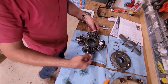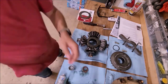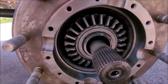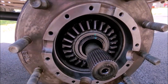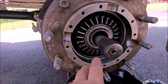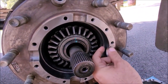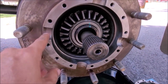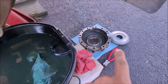The next thing is to replace the four O-rings because this is going back on again. Off camera, I slid the axle back in — nothing too special about it. Just get it in there and finagle with it until you feel it go in and twist it to make sure it's engaged. Next step is going to be putting the whole gear back on, then the cover. Kind of got to do it all together — it's going to be a pain getting everything to line up. You're going to have to push up on the axle a little bit. Put some of the gasket maker around everything. Already got the O-rings replaced. Then once you get all that, you put the snap ring on first to kind of hold everything together, then put the cover on.